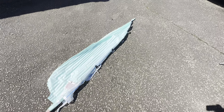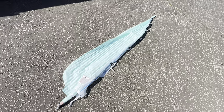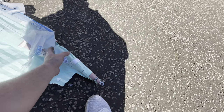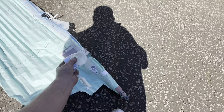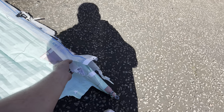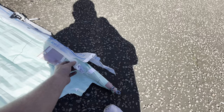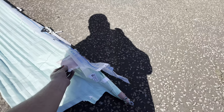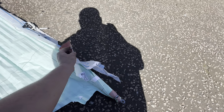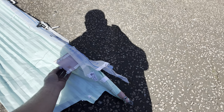Just like I said previously, I won't bore you with taking both sides out, but that is the driver's side curtain airbag there. And you can pretty much see it's in like this. This is almost a paper, like a material, and it's wrapped and it's in that. And then it's just got like rippable tape, you can see, where it actually splits once it goes off. And you can see that that little piece of rubber was actually wrapped around it as well. And it just pops open.